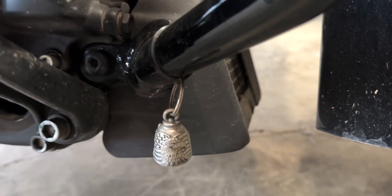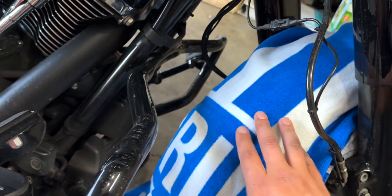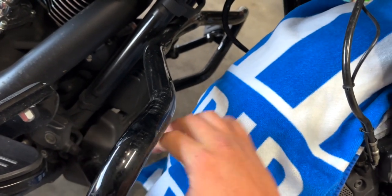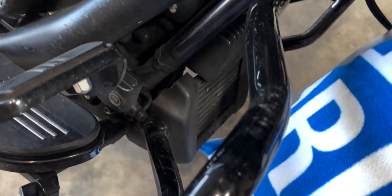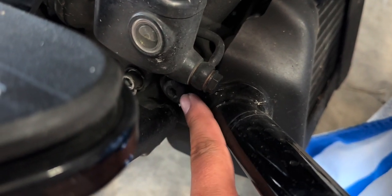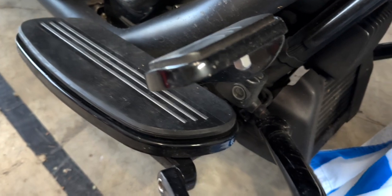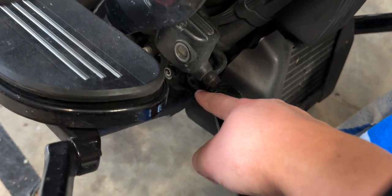First thing I need to do is take off my motorcycle bell — that's important, don't forget to do that. I like to cover my fender with a towel since I'll be working around with ratchets — mainly to protect it from my clumsiness. Now down here at the bottom of this engine guard you'll see a T45. If you can get to that without having to take off your footrest, more power to you.